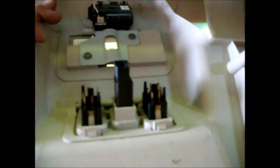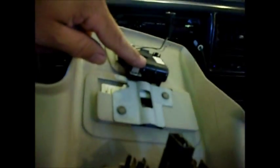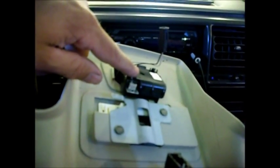I took down the center console — it's just a series of screws, about ten of them. Behind it are all the plugs for the lights, the sunroof switches, and so on. There's one of the motors for your forward sunroof. What I was calling Linksys is actually called HomeLink — it's for your garage doors, the three-button remote on your center console. On the new mirror, it will actually be on the mirror itself.